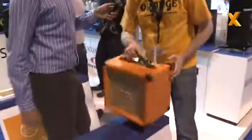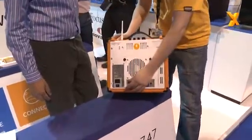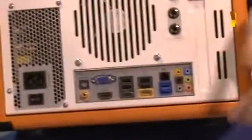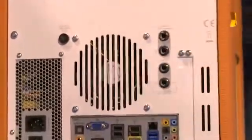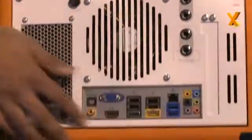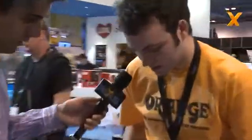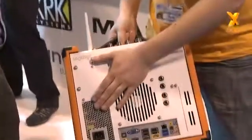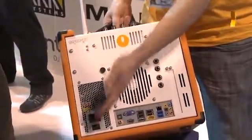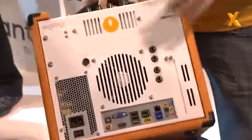Around the back of this, you actually see the computer part of the machine. We have a Sandy Bridge motherboard, and we've got a PCI Express socket, so if you want to add Firewire or a gaming graphics card, if there's anything you feel you're missing. That's H67 standard, so it's built-in integrated graphics. It comes with an i3-2100 dual-core CPU. The PSU works worldwide, so you can take this to Japan or America — it dynamically switches between voltages.